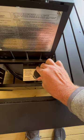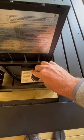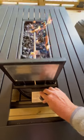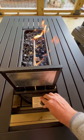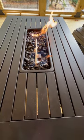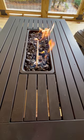Take the left knob, push it down and swing it to the left. You'll hear the igniter begin to start, then you'll hear the gas. If it doesn't start, push down for a second click and it turns right on. Hold it down for a second and let up — your fire is ready to go. If you have any questions, feel free to let us know. Thanks!